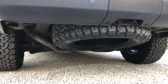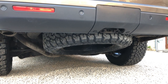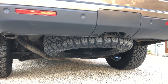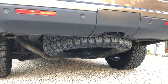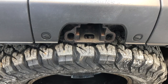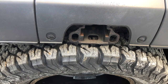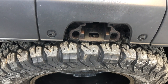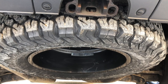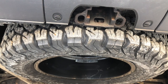So this shows how you can still carry a slightly larger spare tyre and wheel in the standard spare cradle. Other options are of course available, such as carrying the spare on a bumper-fitted mounting — probably the best option, though not cheap. Some people carry the spare on the roof rack, but bear in mind tyre and wheel together weigh 37 kilos or 82 pounds, which is not only a lot of weight to haul up and down but won't help the vehicle's centre of gravity. And if you are going to store the spare this way, don't forget to take along your compressor, because the first thing you'll need to do when fitting the spare is re-inflate it.